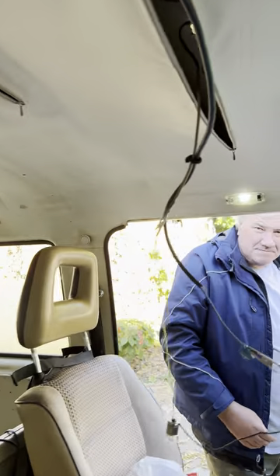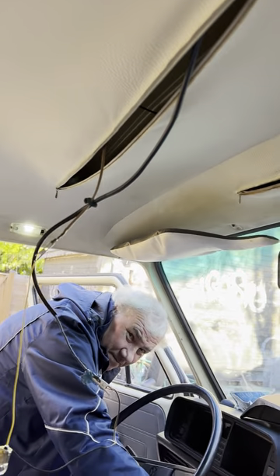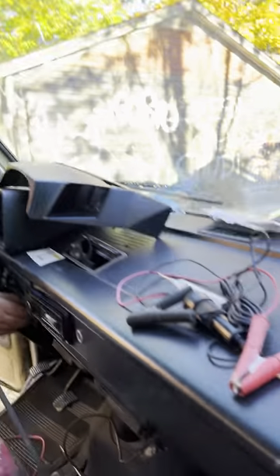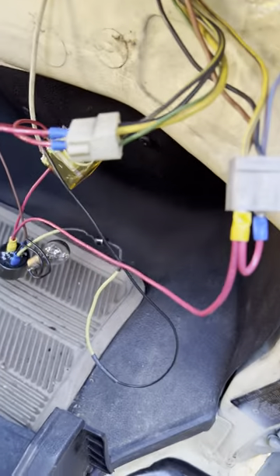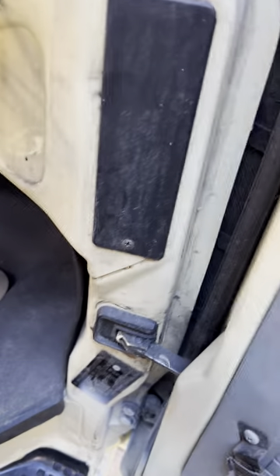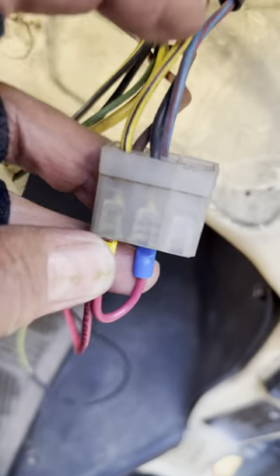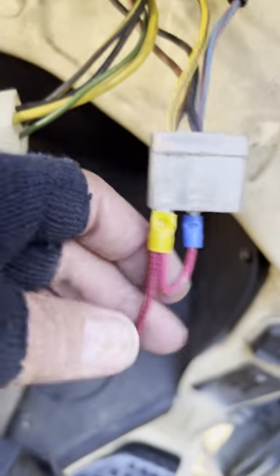The light in the ceiling here is just a test bulb, but that's going to connect to the blue flashing light on the roof. So when we turn that switch on, they both come on. It's not factory, but it's very simple to wire that way. That was accomplished by taking the power from the switch and jumping it here to the blue and red — that's the wire that goes to the light on the roof.